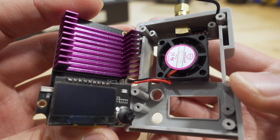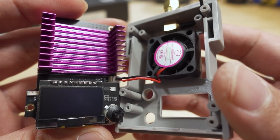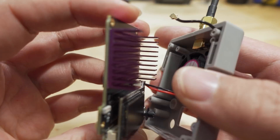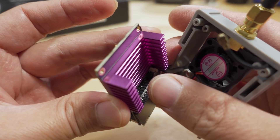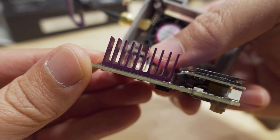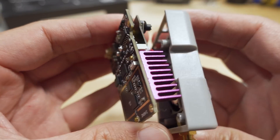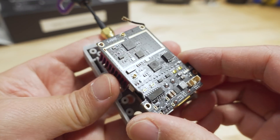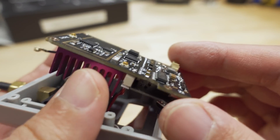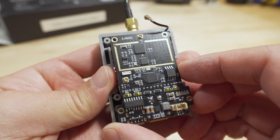Here's what it looks like on the other side where the heat sink is. The fan blows on the heat sink, and there are fins that stick outside the front of the case. There's a little plug for the fan and you can see the screen. But it looks like the heat sink is glued to the back side of the PCB — I don't see it actually attached to any chips like you would expect. The main chips that control the backpack and the main MCU are on the other side of the board.